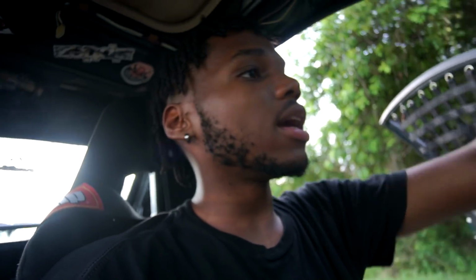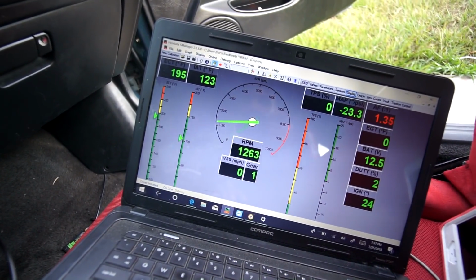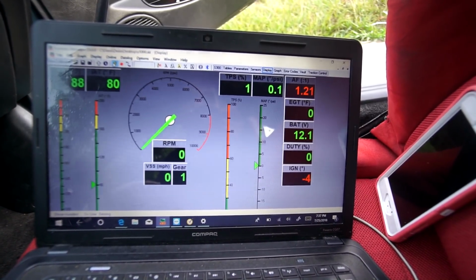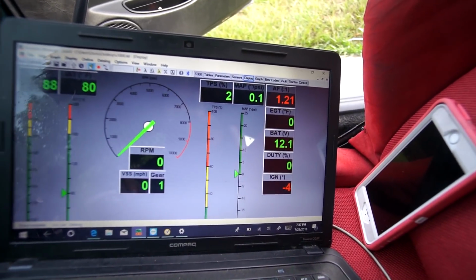Hey, I heard y'all like to gamble, so we finna gamble, you know what I'm saying? Let's play some bets. Did Zosh calibrate his TPS properly? I got a check engine light flashing up. Okay, now it's on. Okay, now it's flashing. Okay, I don't know. But we're gonna find out right about now. Is my TPS calibrated properly? Let's see. Damn it. Nah, it's not. Oh, wait. Somewhat. Should be reading 0, but at 100% throttle. I mean, maybe that's fine. I don't know. Why do I got a check engine light for?